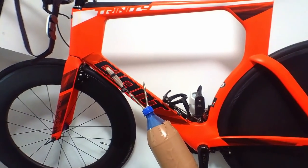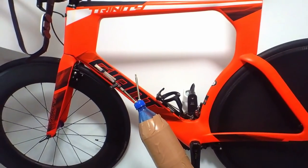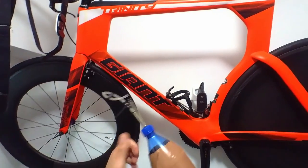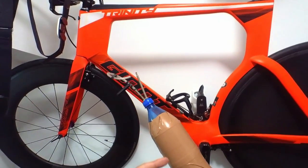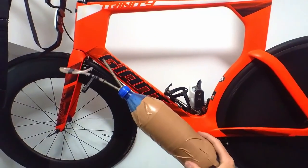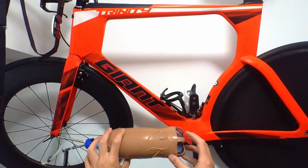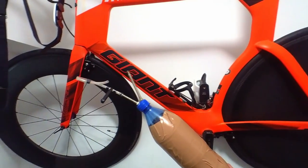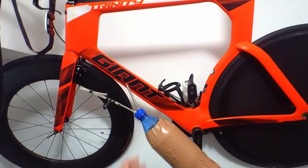Is it safe to do something like this? I think these bottles are designed to take quite a bit of pressure — when they're packed with carbonated fluids, shaken up, and in hot transport environments, they must handle quite a lot. To increase the hoop strength of the bottle I wrapped it in fiber packing tape, which is really strong in tension, and it's the hoop stress which is the biggest stress in a thin-walled pressure vessel. There's also axial stress acting on the cap and end, so I put a bit of light tape across the end to brace that. The first thing that will probably happen is a leak up here somewhere, or maybe the cap will fly off the thread, so I'll put a bit of tape around the cap.